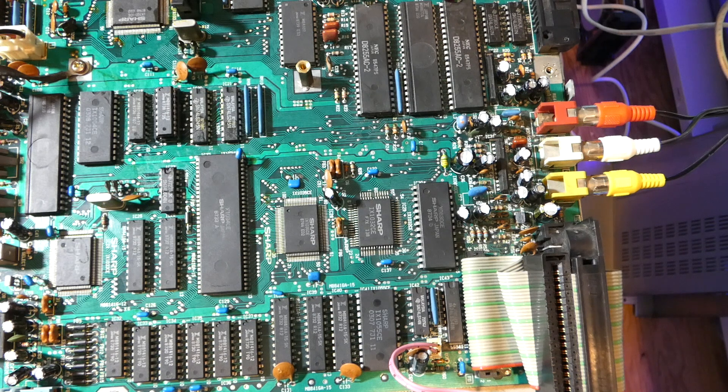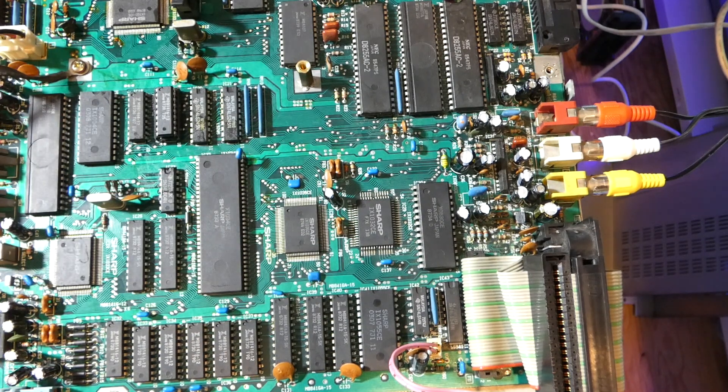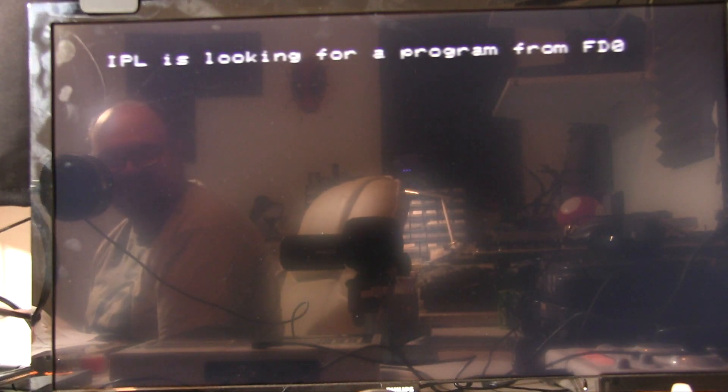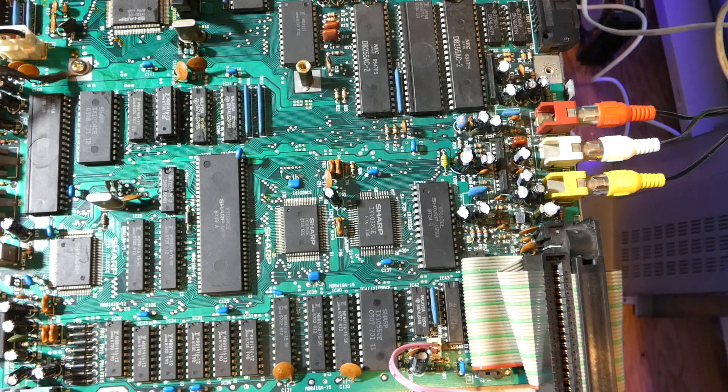Okay, so we have replaced that memory chip. Right here we've got a new memory chip in a socket. So let's try powering her on. Yes — there we go. It's a bit of a relief. This wasn't completely plain sailing getting the chip out — it did not want to come out. In the end I had to resort to using a heat gun, which I don't like doing because it's very easy to heat shock a motherboard like this and break it further. But we appear to be fine. I won't really know until we put it back together properly and give it a proper test drive. Let's turn it off and try reassembling it.